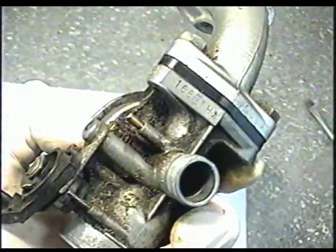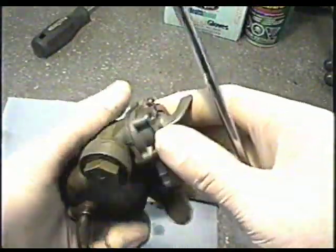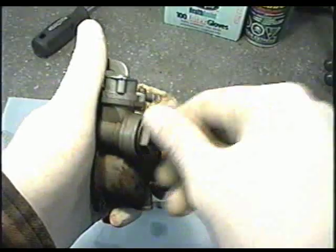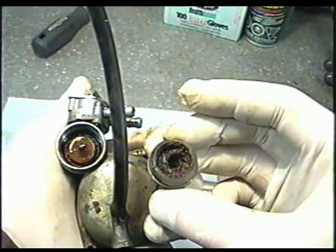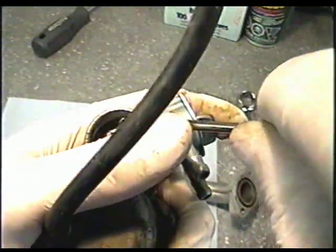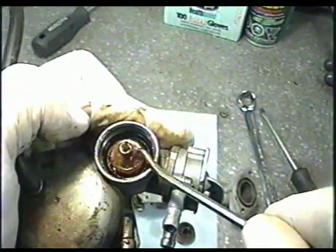This idle screw I'm just going to leave in because it's just to set the idle. On the bowl of this carb there is the petcock valve, and you should always remove the bottom nut here — it's a 17mm nut — to see if there's any dirt in the bottom, as there's like a filter screen in there. This one is just caked with dirt, which is really bad, so that's going to need a good soaking for sure. You can pull out the little o-ring inside here with a pick, but be careful because it might be brittle — you don't want to pull on the plastic too much because it can break.